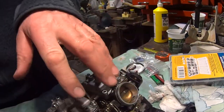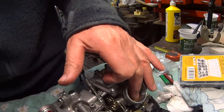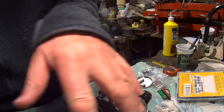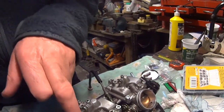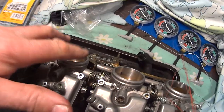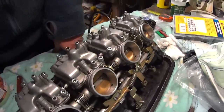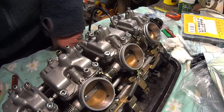And then you can set this set so they come to rest with the throttle screw there, and once you've done the individual pairs, with the center one there, you can set the two pairs to come to shut together. So by eye actually really works well. You can get them really well adjusted.